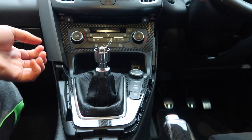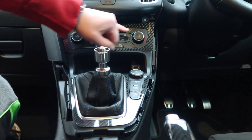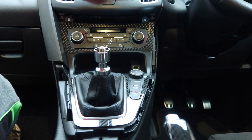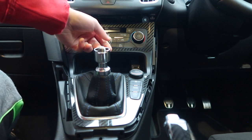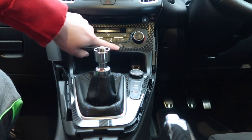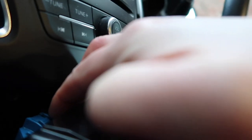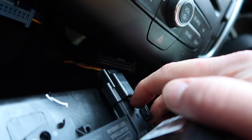At this point we can't just yank it away because there are several electrical connections — for the 12 volt, the buttons, and the USB. There are three different plugs around the back. There are two large ones just right behind here, two different colors, with plastic tabs — push the little plastic tab and wiggle them out. There's a smaller one that's sort of behind around here. Similarly, these always have a plastic tab that you have to manipulate and then they should just wiggle out. There's the blue one. The little plastic tab is just at the back — push that down and it pings right off.